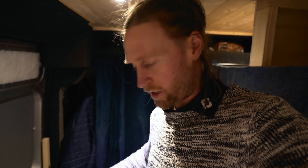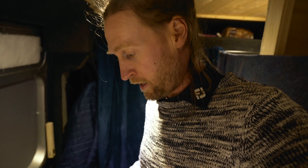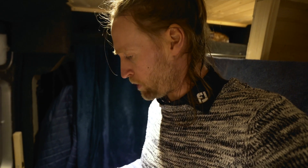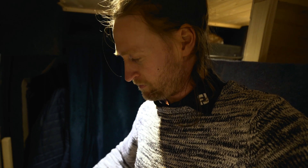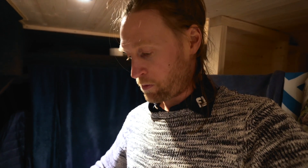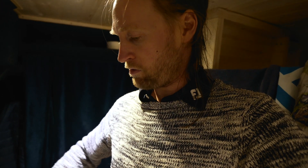I'm going to have to do the hobs one at a time. I didn't realise how much power these induction hobs actually use — just one pan of water is 1800 watts, so both together is nearly 3500 watts. After only two minutes of cooking we've already used 12.5 amp hours, which is like an eighth of the battery. When I was saying we might get away with just one or two batteries, I think that was being optimistic — I'm pretty sure we're going to need three, unless we put loads of solar panels on the roof.